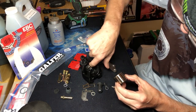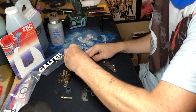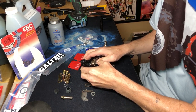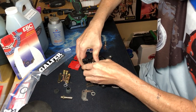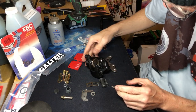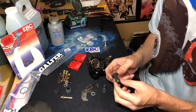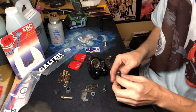Then we're just going to take the piston - you want to get it even - and push that dog all the way in. Next we are going to - we had to reuse this boot but I cleaned it up nice. This one came out of the rear and it looks like it's right. What we're going to do with this is get some waterproof grease and grease up the inside of that. This is kind of tricky - we'll take this guy, he seems a little more flexible, so we'll dump it right on through here and there you go, it comes out right on through.